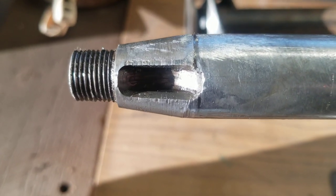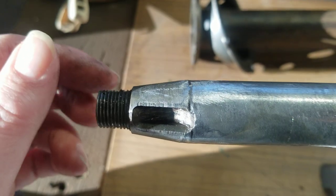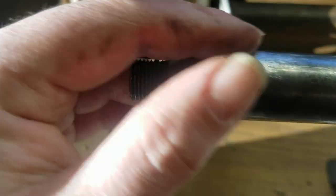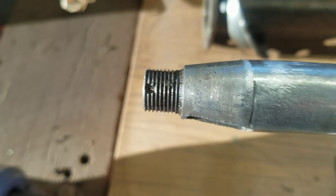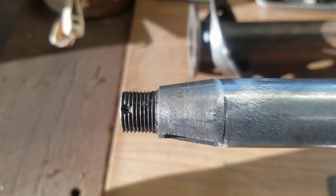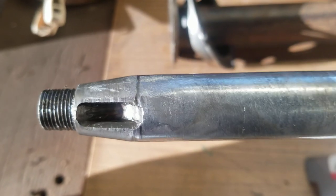Now down at this end of the drive shaft, one of the first things we see is this big lip here, so you can't get the new bushing on. There's a lot of wear, a lot of lip. I tried to sand and file the lip off to see if we could save it, but then when I roll it over, we're going to look at this keyway.